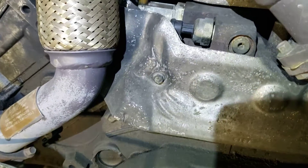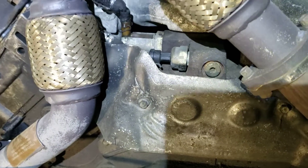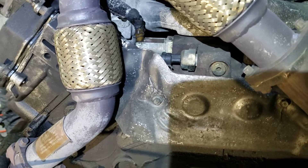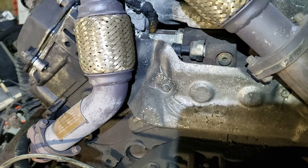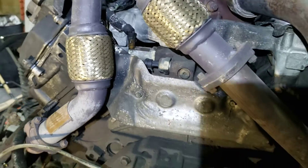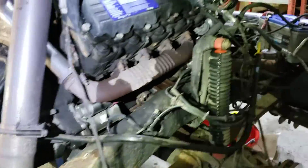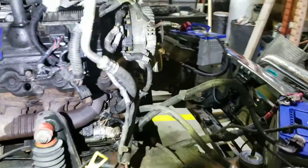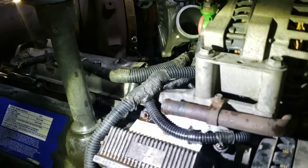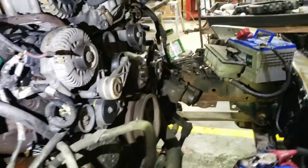The IPR and ICP don't look like they're leaking, but they look old. Being that they're in such a bad location, that's a trade-off — sometimes you want to replace those two sensors because they're the ones that'll shut you down. It's not like the '05 where you can just reach over to the ICP off the valve cover and unplug it. All the glow plugs look terrible — real burnt out — they'll need to be replaced. For the module, being an '03, I'd put a good used one on and keep one with you.